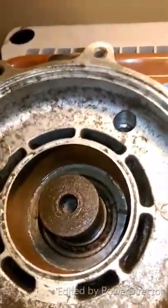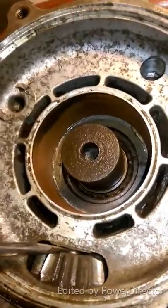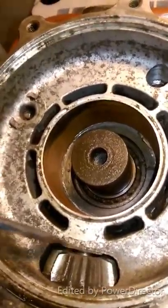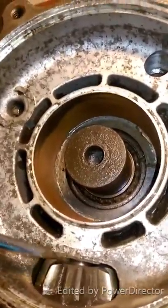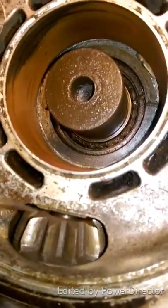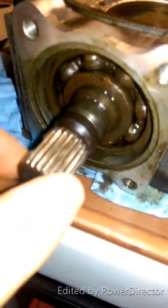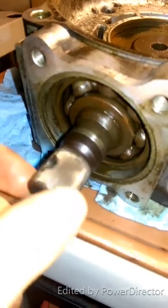Since mine's a little stuck in there, I'm going to put a screwdriver in carefully and see if she'll pop out. She's got a sleeve inside this — there's a nipple on here where there's a sleeve. We've got a new one in our rebuild kit. So we're going to see if we can just get this pinion out for now. Letting that sit with some oil — can't get it out. Everybody else has seen it had a snap ring in here; I don't know if that's missing or I just don't have one, which is kind of weird.